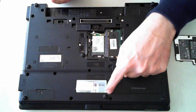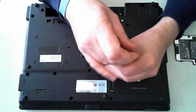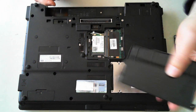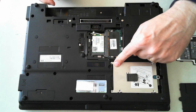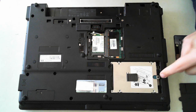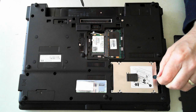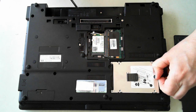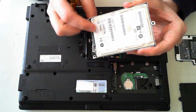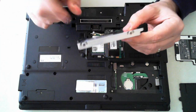The hard drive itself is in this little panel here. Just loosen these screws — these screws won't actually come out. There we go, and we've got the hard drive in here. As you can see there's a little guide here on how to get it out, and there's one more screw just in here. Remove that screw, then it pops up and you can just pull it to the side. You've got the hard drive in there — it's just a normal serial ATA hard drive.